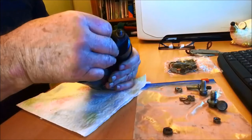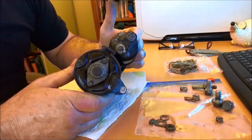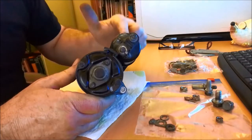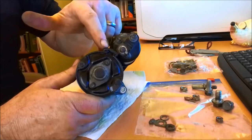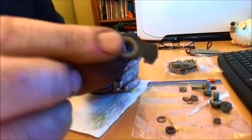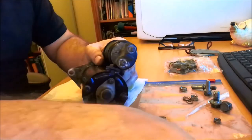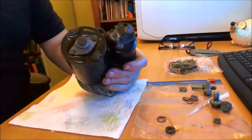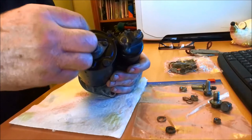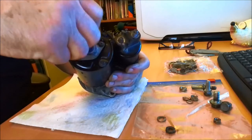I knew when I was sitting in the car that it was an earthing problem because the solenoid wasn't even clicking. Normally if you've got a sticky starter motor or flat battery, your solenoid will still click as it tries to engage — there's just not enough voltage to turn the engine. So we take that off. That's the broken button — there should be a piece of braid on the bottom of here to this terminal here. It's gone, it's rotten. Next — 7mm. These are 7mm. They're not particularly tight, they don't need to be particularly tight — they just make sure they're not going to come back out.